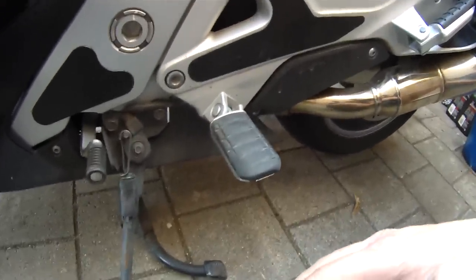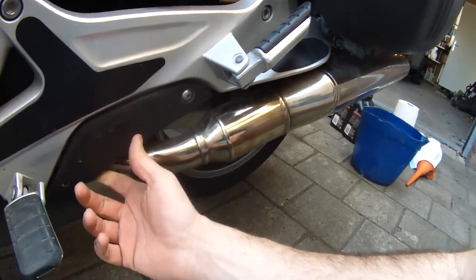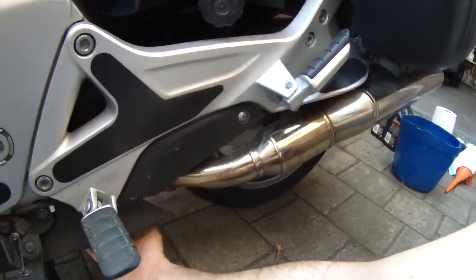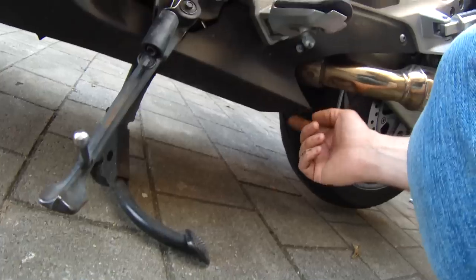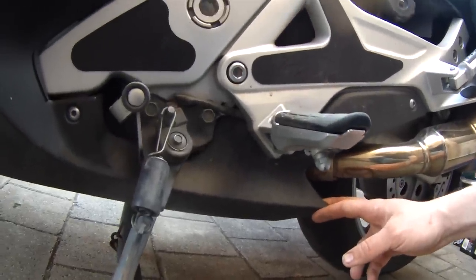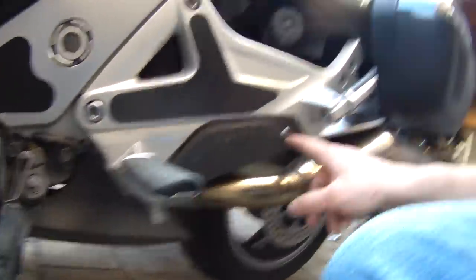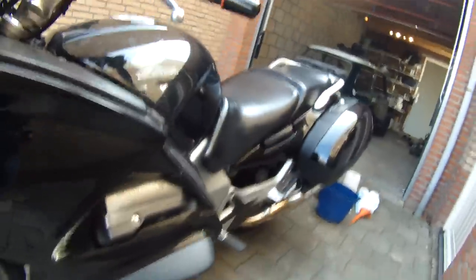Let me do a quick walk-around. This is the panel I'm talking about removing — it's this plastic panel near the foot board. The oil filter is right under here, and I just don't want to get oil on the bottom of it, because once the exhaust starts getting hot I'll start to smell it. So I'm going to take it off, which requires removing five 5mm Allen bolts.